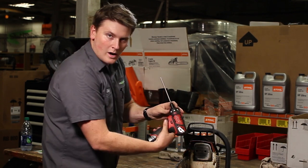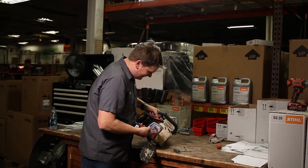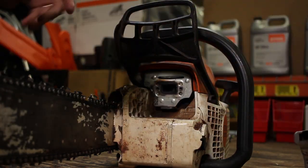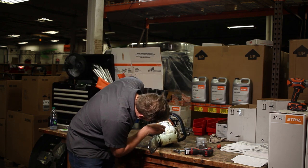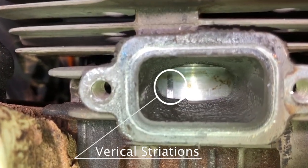I have a handy-dandy Milwaukee drill, which I love. Remove your muffler — this is a T27 wrench, it comes with your chainsaw. You pull your muffler off, pull out your handy-dandy flashlight, and you just look right up that hole. Then you slowly pull your rope, and it allows you to see — you can actually see the piston move.